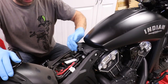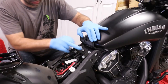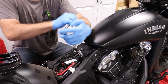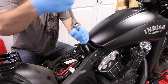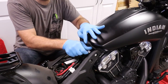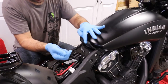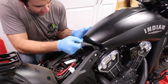Time to start removing the tank. We lift this rubber flap over here and we have those four bolts — we're gonna remove those four bolts completely. It's much easier to work on a brand new bike; everything comes off fairly easy. Bolts out, let's keep going.